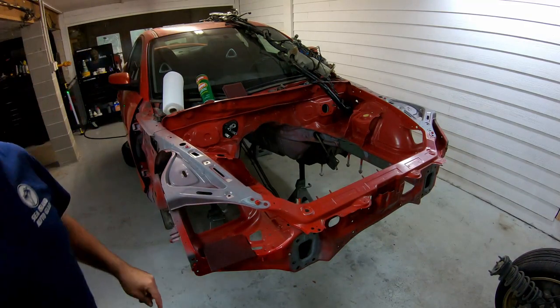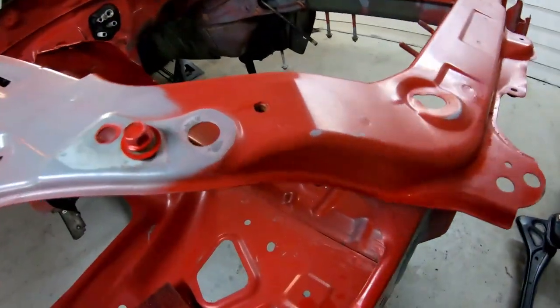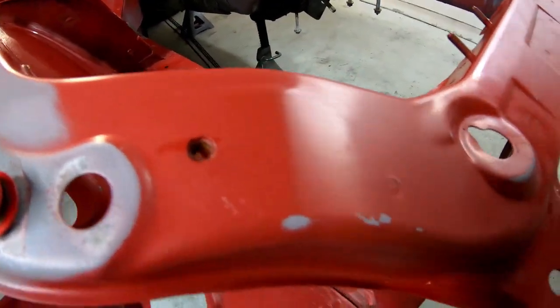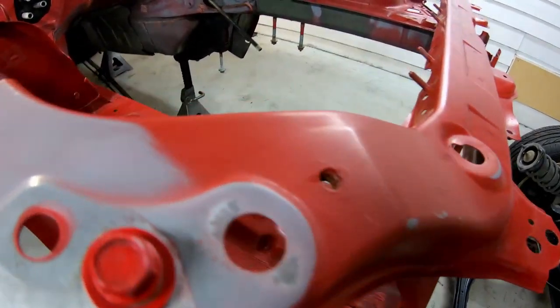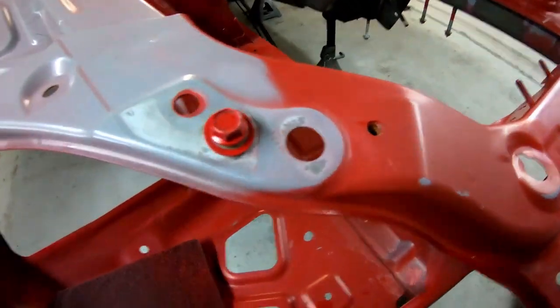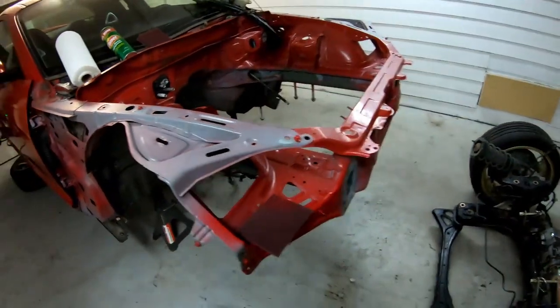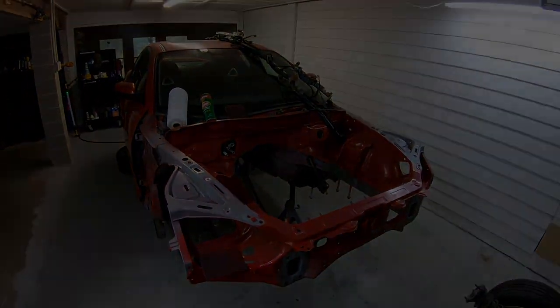And that, getting in close. Now that is sanded. It's not shiny like over here. It gets dull. So that, with a little bit of wax and grease remover, will be ready to paint. Gotta do the whole thing, and then we gotta clean it one last time.